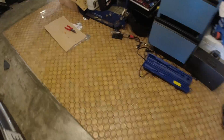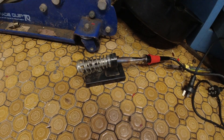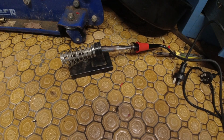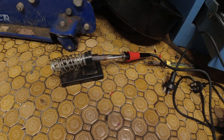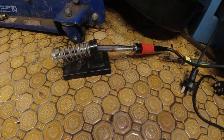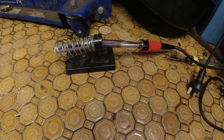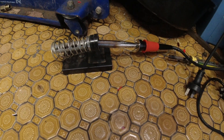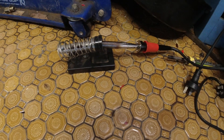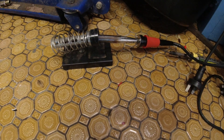One other thing — at the start of this video I mentioned all the materials cost $99. What I found was that I had to go and buy a more powerful soldering iron to be able to penetrate those 8 gauge wires. This soldering iron costs 50 bucks from Super Cheap — it's a Toledo brand, 100 watts, and it absolutely just ate through those wires; it heated them up so fast. So just keep that in mind: $99 plus 50 bucks for a more powerful soldering iron than your basic entry level one. The benefit to me now is that I have a 100 watt soldering iron for anything in future.